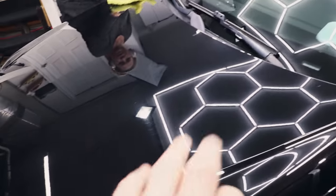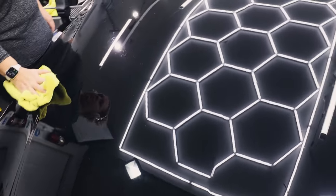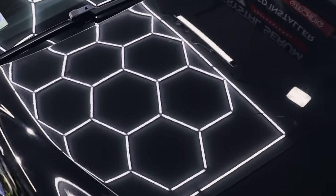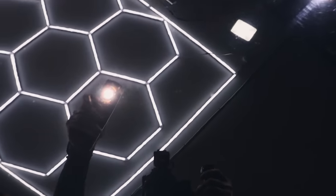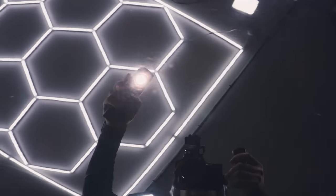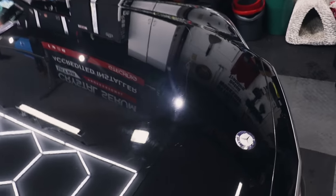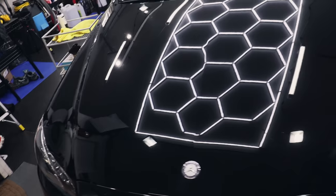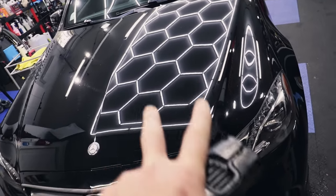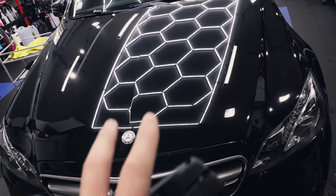We're cutting pretty deep, but the polishing cycles are not so long that we're heating up the pad and heating up the panel. It's like two slow passes and then maybe another lighter pass, and it really clears it up. This actually looks better. The second cut does a little bit better. So that's what we're having to do. We're having to cut it twice. And again, we're going aggressive, but we're also checking along the way and making sure that we're not going too aggressive.